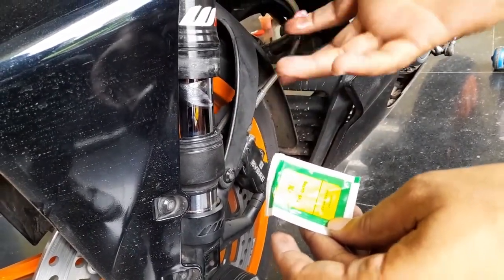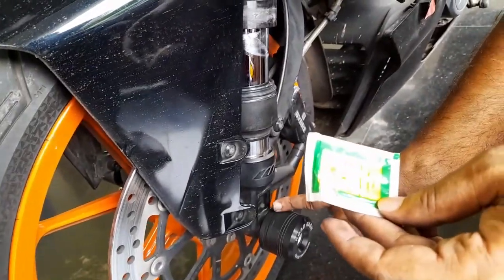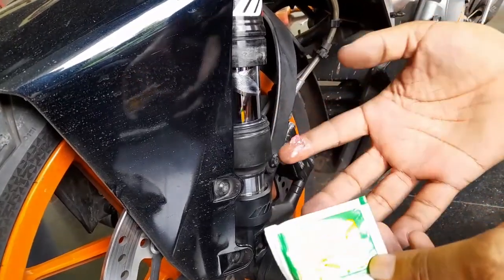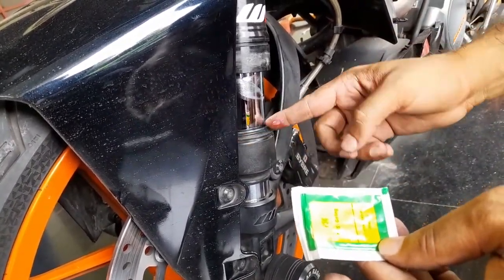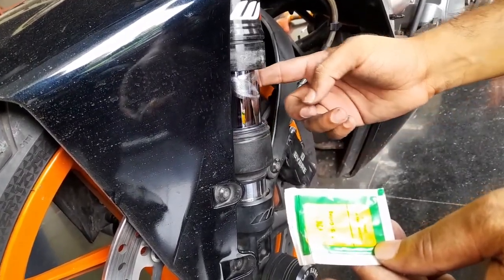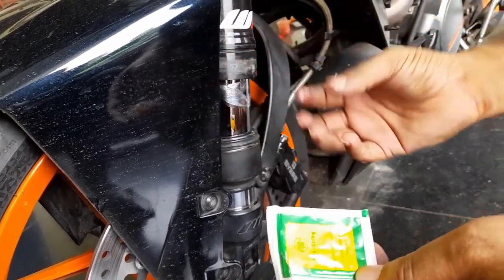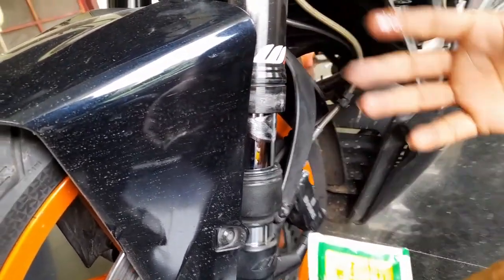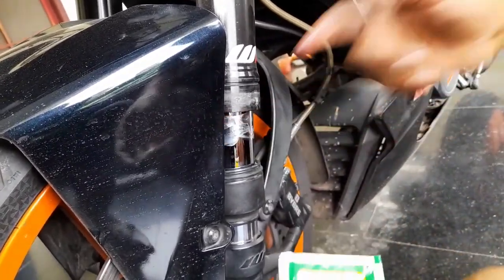Normal grease or bearing grease is okay for a different kind of seal, which is used on that. So that will dry up faster. This will take more time. The rubber seals are more friendly with it. With the normal bearing grease, what will happen? The rubber seal will swell up after a time. So that's how I made the mistake.